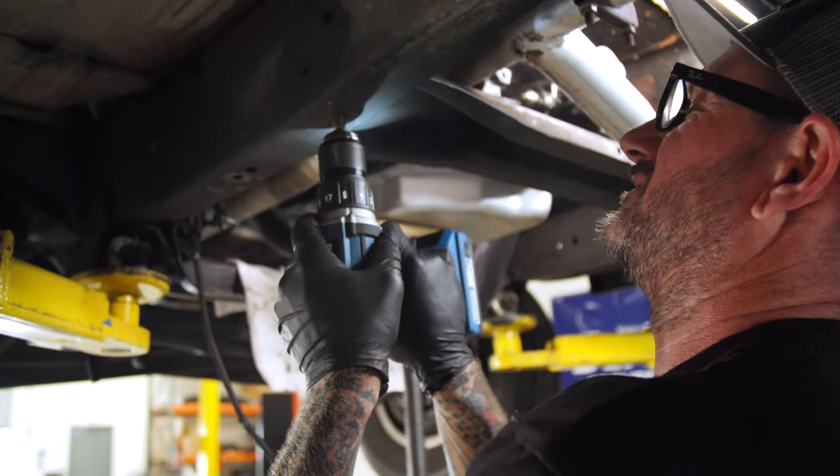The torque converter is done. Let's see if I can get this dipstick in from the bottom - it goes right here. I'm going to take the old battery cables off. We've got a new one that goes straight from the battery to the starter, not to the solenoid any longer. We're not going to use the solenoid because the solenoid is now on the starter itself.